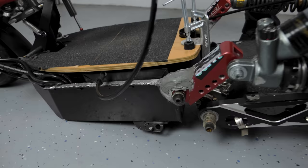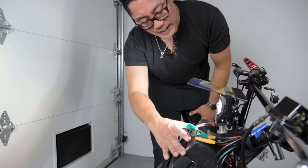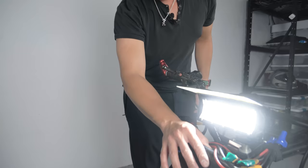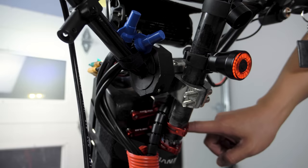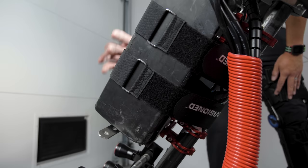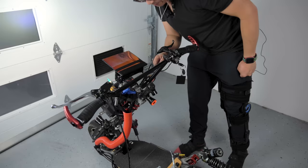You can just kind of see the battery under that deck — that's a huge battery. So that's an 84 volt, 24 amp hour battery. I got inspired by the Dualtron extended battery mount. I saw some videos of them going 80 kilometers and they all had these packs. I was wondering, what are these things on the front of their fork? Just looked at some pictures and then got some mounts on the back. So I can add another — this is another 84 volt, 17 amp hour battery. Got some bicycle clamps, just like a standard bicycle frame for adding another water bottle mount, got some stainless steel plates, screwed everything into it. It's supported at the bottom, and then just some Velcro straps. So all together you have about 41 amp hours at 84 volts.